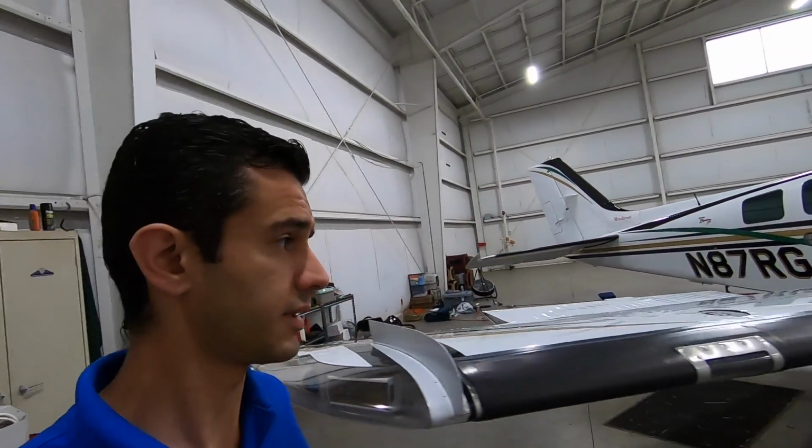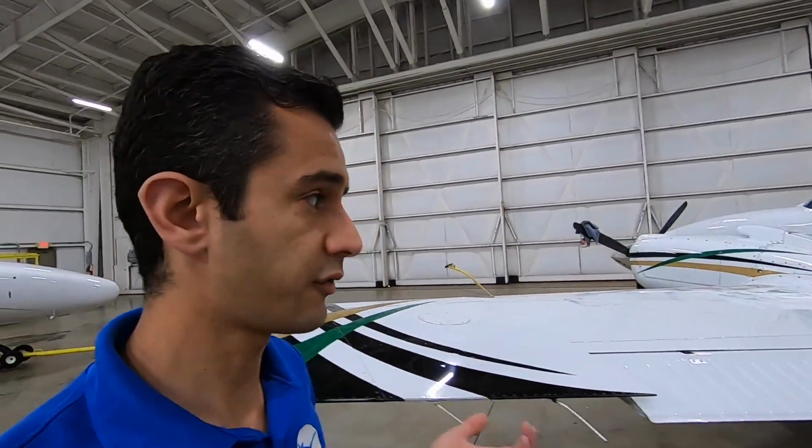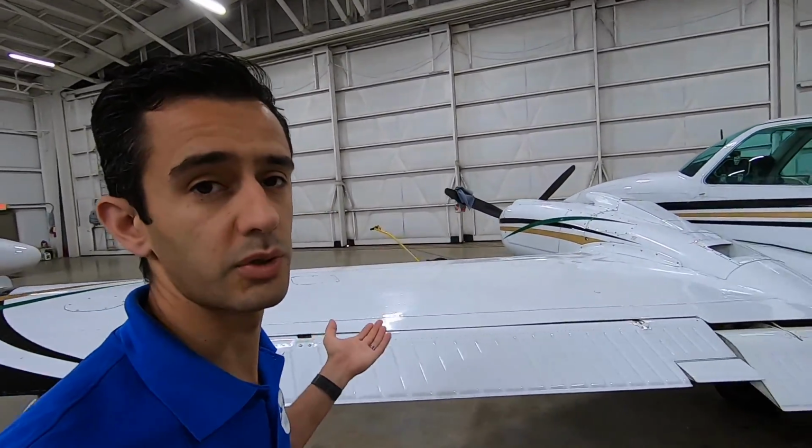The airplane is coated. It is Sunday morning now. That was a lot of work. Pretty tired. Anyway, so after paint correction, to get all that oxidation and staining off, I panel wiped the whole aircraft with an alcohol solution to get any oils off that might interfere with coating. Then coating is wiped on, wiped off, and the plane looks beautiful now.